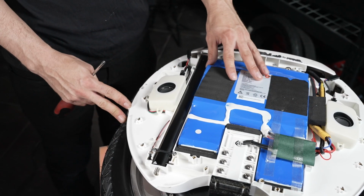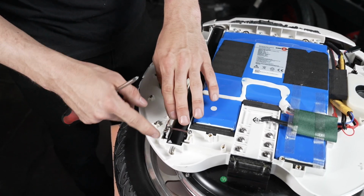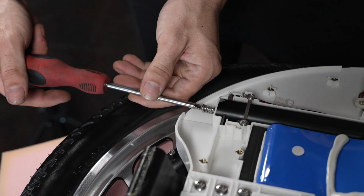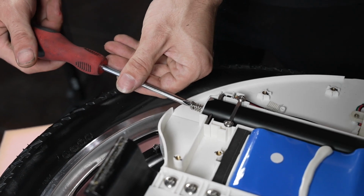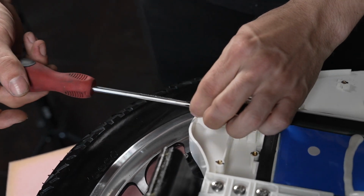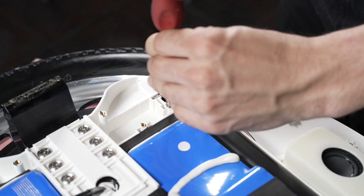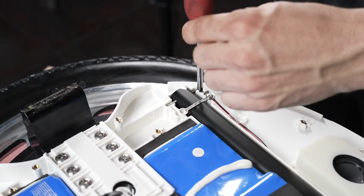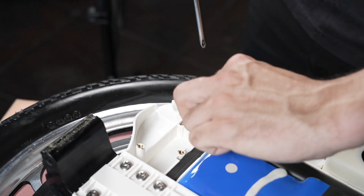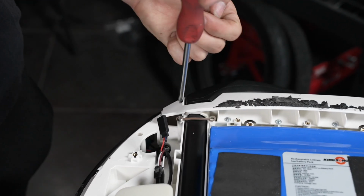Now that you've taken the side panel off of your 18XL, we're going to be removing the brackets holding in the trolley handle. And we're going to be removing the bottom screw that's holding tension. When removing, be careful as the spring can push the screw out after the threads are loose. For less work putting back in screws, just remove 1 on each of the brackets and then lightly loosen the opposite screw to move the bracket out of the way.